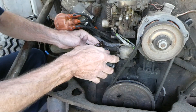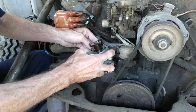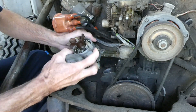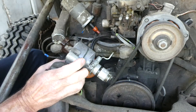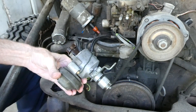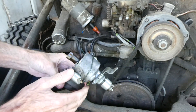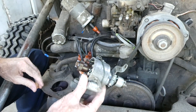You've seen a lot of those wave washers. There's our distributor. We don't want to loosen the clamp right there — once you do that, your timing is all out of whack. So we can put this one right back in and it should be running again if we want to.